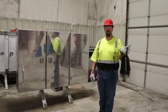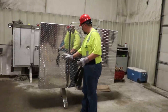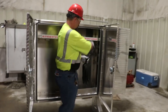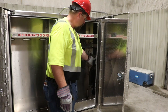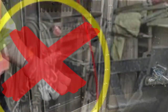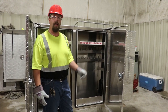Once you've gotten your bungees bundled up after taking them off your load, they are not to be hung on your steps, on your APU unit, or on the outside of the trailer. You can either hang them from the top shelf, or on this side of your vault in the chain compartment there are three rails welded in that are perfect locations to hang those bungees as well. They need to be kept inside to keep them out of the weather so they don't weather-check and dry rot, because the biggest enemy of rubber is sun and moisture. Keep them in here out of the sun and dry when not in use and they will last exponentially longer.